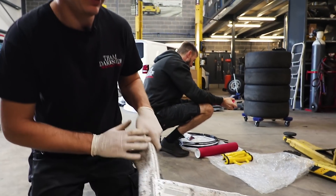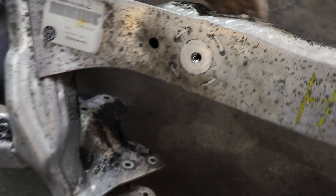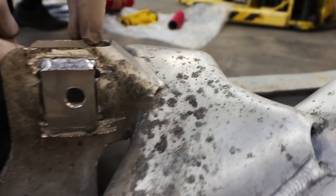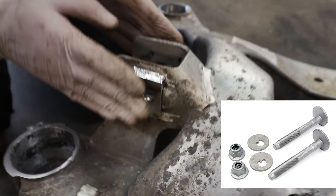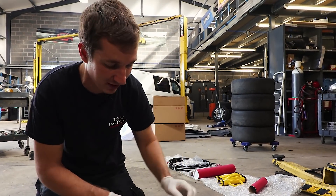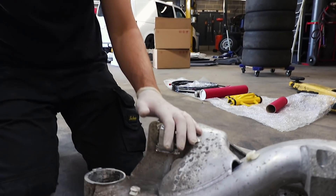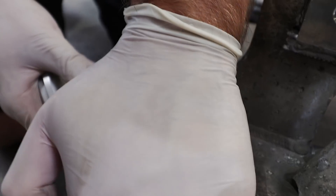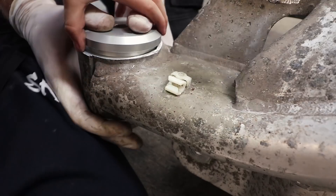The bit that Dan had to weld is here at the back - we've welded that up, that's a lot better now. The other bit we've welded: we've put some little plates here. These are normally slotted with an eccentric cam bolt, and they're a bit of a pain to get at and they move around a lot. This is an adjustable arm anyway, so rather than having end adjustment, we've put them in and locked them off so they'll just be fixed. Dan's managed to get the bushes out - they're a very tight fit but they'll tap in there. One goes on the bottom and they're solidly mounted.